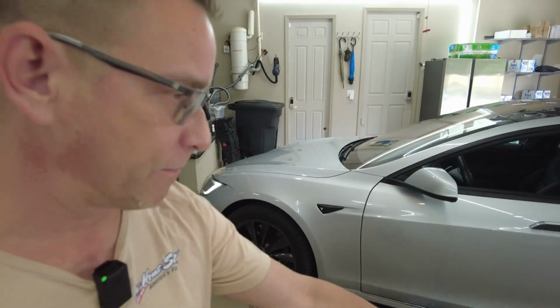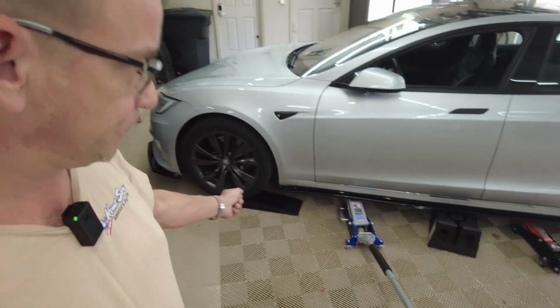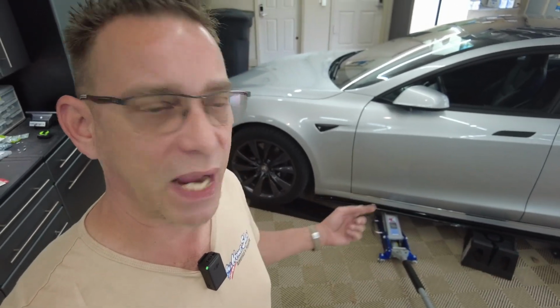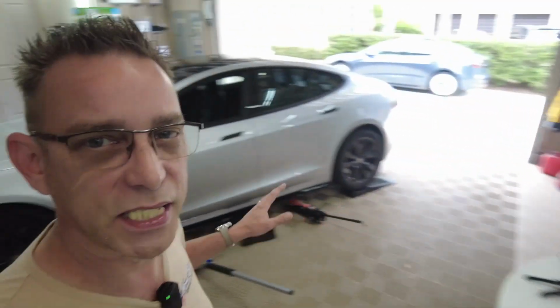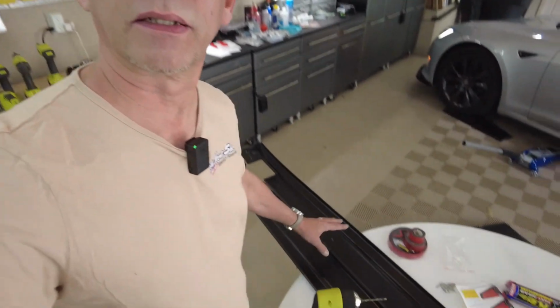I don't even have the plastic coating off of it that you're supposed to peel off. I think I'm going to have this one up there and align and use my best decision on where to pre-drill some pilot holes, and then I'll take that off and sandwich it on top of the other side and pre-drill in the same spots, so they've got the same spots where the screws are going in on each side. Stay tuned.